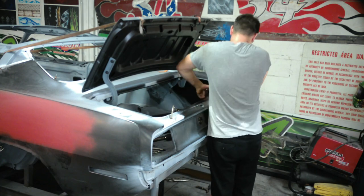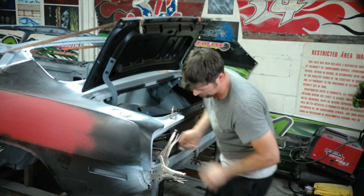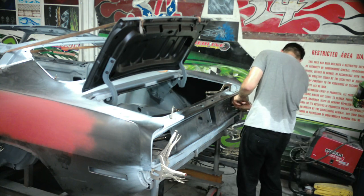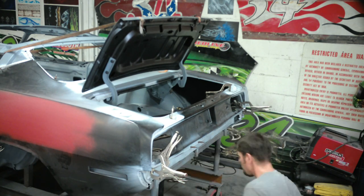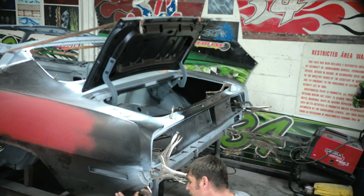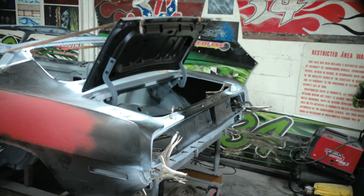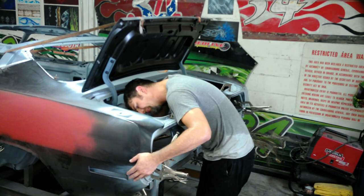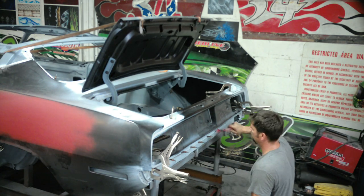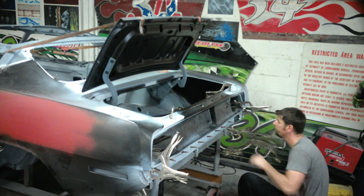All in all you can see it's fitting up pretty good. Here we are clamping the lower corner pieces — the part we didn't weld into the tail panel. Every now and then I'm closing the trunk making sure my trunk gaps haven't misaligned. You don't want to do one thing and upset it somewhere else — every action has an opposite reaction. Keep checking because everything's a compromise. You might have to move three or four panels to get the gap you need. The only things I'm using to modify stuff are a port-of-power, monkey on a stick, and body hammers.